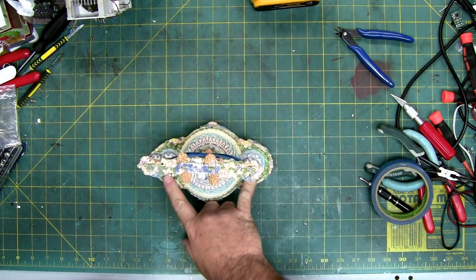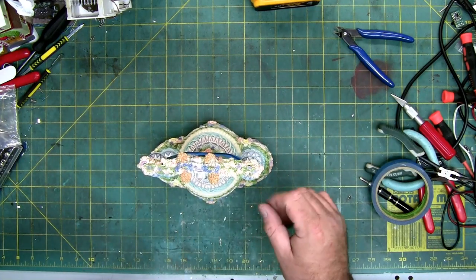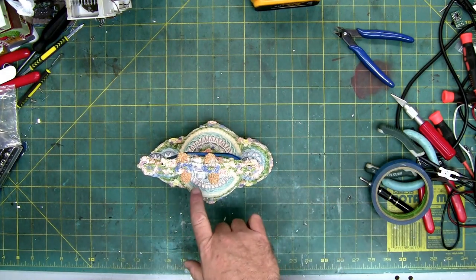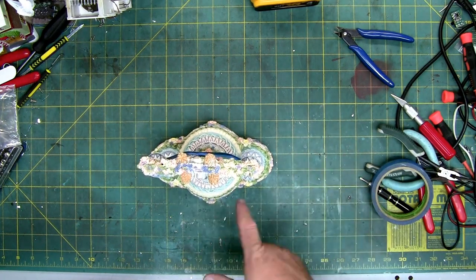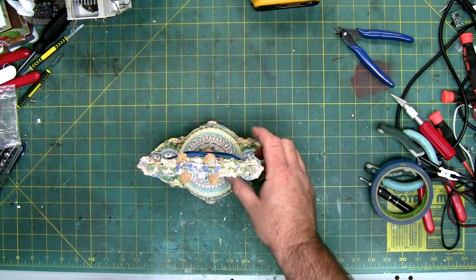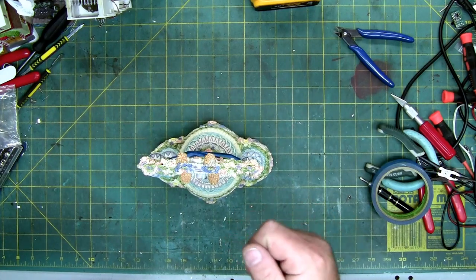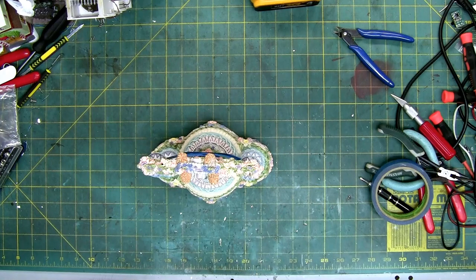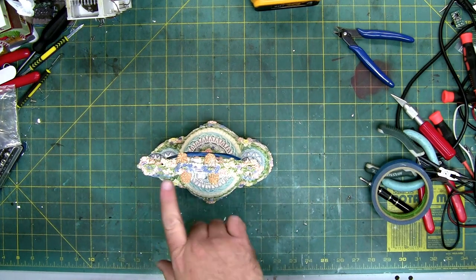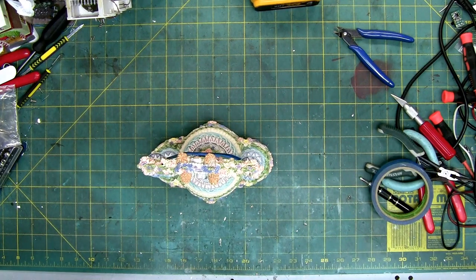Take it apart, put the screws back in, dab of glue on each of the poles so that way they don't fall off inside. Unbind the mechanism, little dry lube to make it spin again, and then a dab of super glue on the shaft to bond it back to the gear so that way it goes up and down, and then some Gorilla Glue to fix the arch so that way it'll cure. It's just slow. Super glue would work too, but you have to hold it.